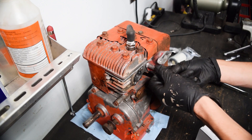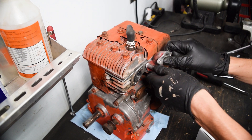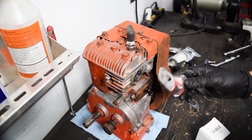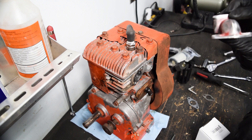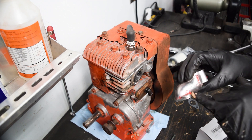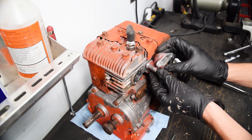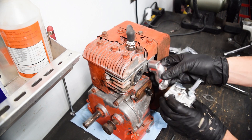I did a lot of guessing with the intake. I really wanted to use a round-slide Mikuni style carb and had lots of intakes to pick from, but they were all just far enough off that I couldn't make it work easily - especially for something that's supposed to be a budget build, not a bespoke machining build. So we ended up using this intake again, which is the same one I used on the three and a half horse Briggs on the budget mini bike build. I found the real part number after a lot of searching, which is 28416A. It's a composite intake, direct bolt-on and requires no finagling. You can mount it with the carb up or down below depending on your setup.